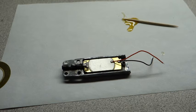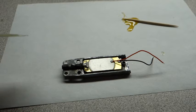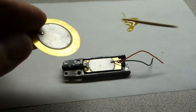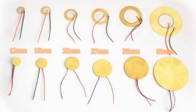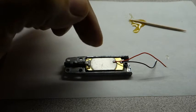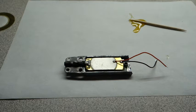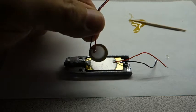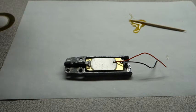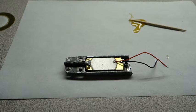This is what it looks like when it's done. I just tested it and it still works. If you're wondering what size this is, it's 35 millimeter, which is 1.37795 inches. I bought them from China. You've got all sorts of different sizes but the bigger the better if you can fit it in there. They tell you not to cut the ceramic part, but it does still work — I haven't had any problems. If that doesn't work for you, try the smaller ones; they'll fit right in without cutting, but I don't think they'll be as loud and they may sound too high-pitched, too much treble. I'll continue this video once this hardens up.